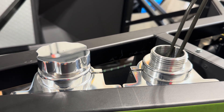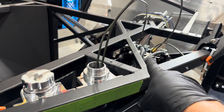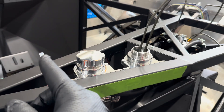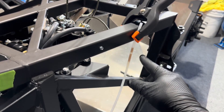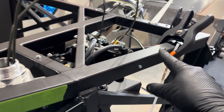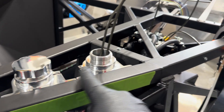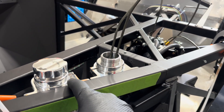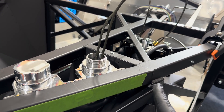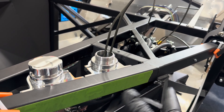I did take a fair amount of time doing some measuring. I was also worried about whether they'd be high enough to gravity feed the master cylinders. To evaluate that, I put up a water level — just a tube with some water in it — which shows you level. With the water at about this lip, it will feed the master cylinders, which are actually a little bit lower than here. So as long as I keep them topped off they should gravity feed. And I noticed while doing the bench bleed there is a bit of suction involved as well.